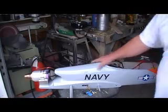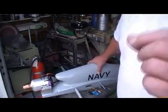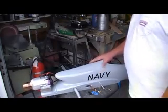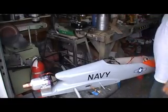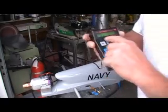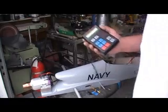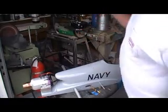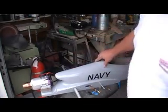Pump volts are only 1.8 — that's almost nothing. And the pump volts are at 0.3 now. At full throttle they're at 1.8 — you can go up to 6. The better your fuel system, the lower your pump volts.